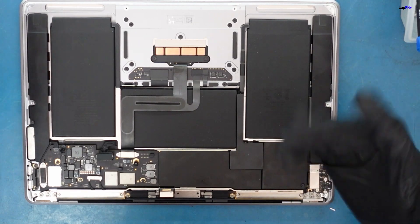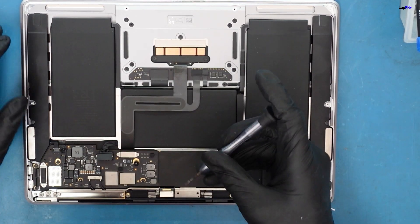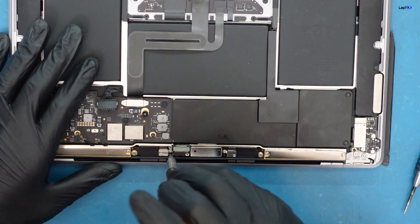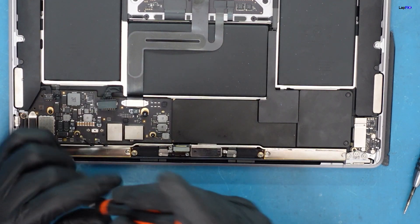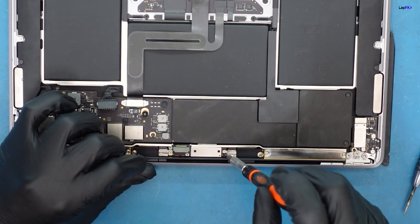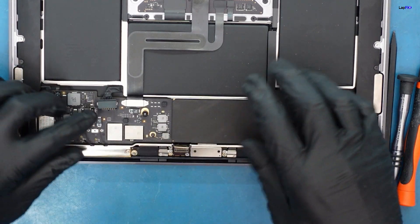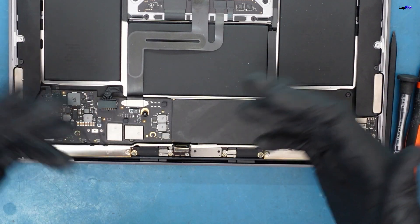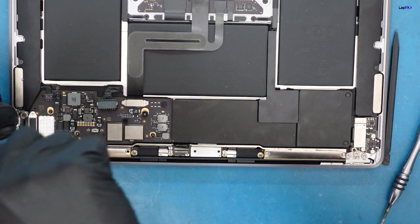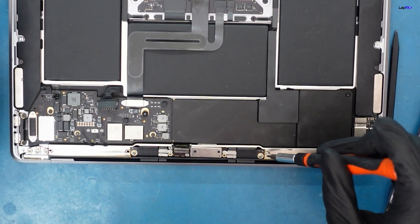We already have the battery disconnected because we just did a repair. The customer did authorize the replacement screen for this one. It's really unfortunate — we do a full diagnosis and we always like to let our customers know, especially if we see any damage like to the LCD connection or this area, that there's a possible short that could happen and there's no way to really tell until we're able to at least do a repair on the logic board. There's no obvious liquid damage to it. It's a very clean looking LCD, especially since it's turning on and there's only a problem with the backlight.